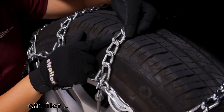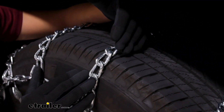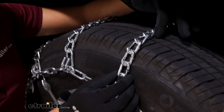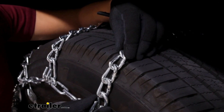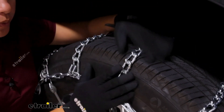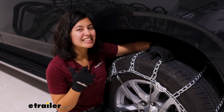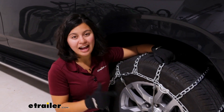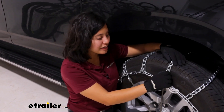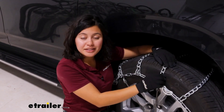These are what the twist links look like. The pros of twist links is that snow is less likely to clump on them compared to square links, but they still give that extra traction. These are going to be made of a low carbon steel, which means you have a good amount of durability. The downside though is that steel tends to rust more than alloys, so if you're planning on using this for multiple seasons, I recommend storing them inside a tote with some oil, or else they may rust together.